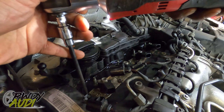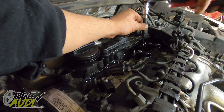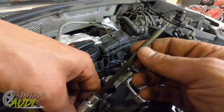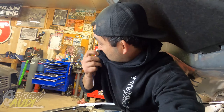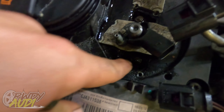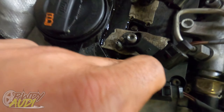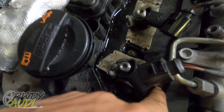I still got to show you guys how to code them. In order to get all these screws out, you're going to need a four millimeter — I'm using a Harbor Freight long reach with a three-eighths to quarter-inch adapter so I can use it on my ratchet. We got to take off these covers right here and they're pretty easy to come off — just pull up and rotate a little bit. You want to make sure you take notice of the orientation that you have them in because they only go back in one way and rotate to lock into place.